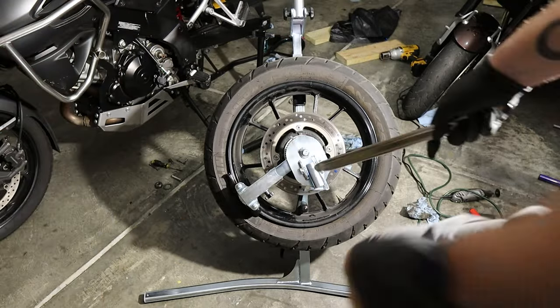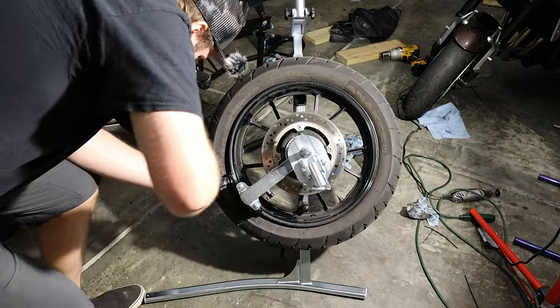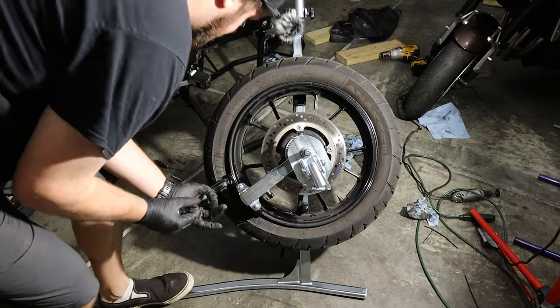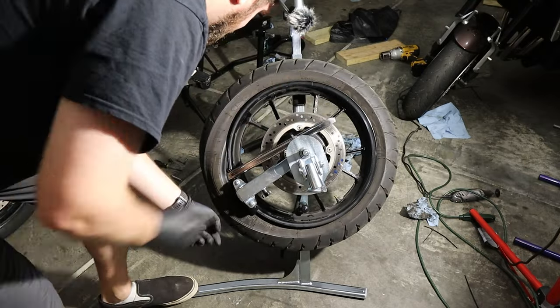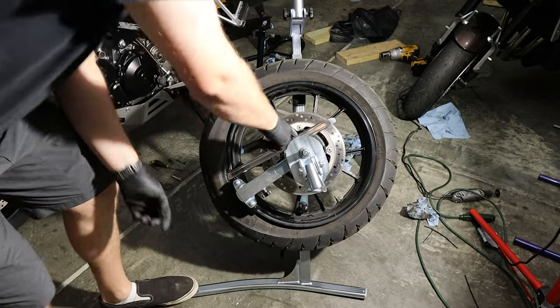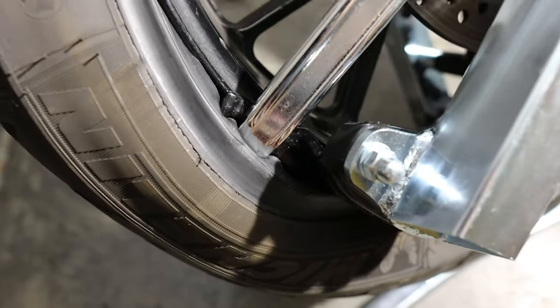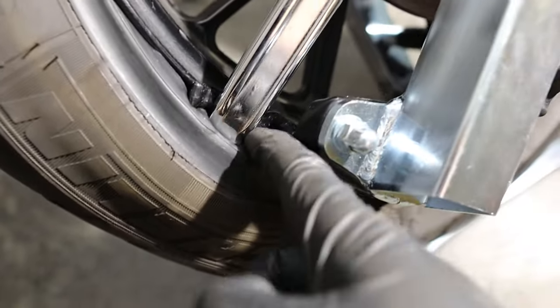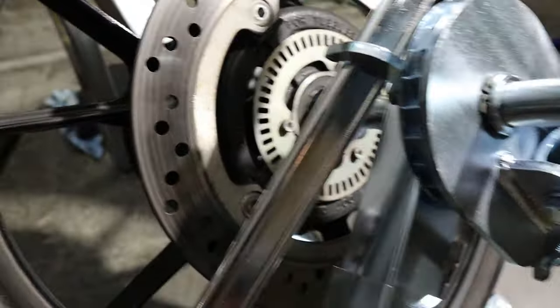Having your wheel up against the pin will stop the wheel turning when we're ratcheting around. Now we want to lift the tire over the duck head like that, and we can hook it in here. Essentially we have the wheel iron in over the duck head and then it loops into this nice holder here.